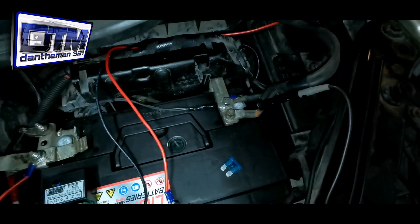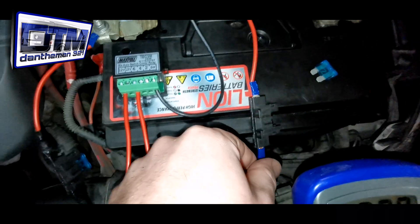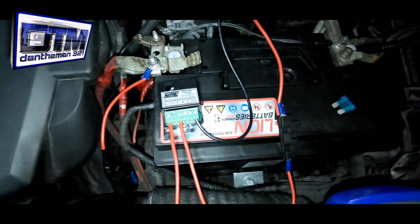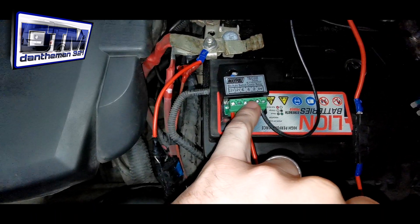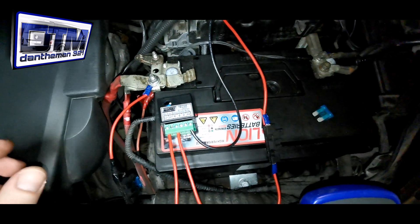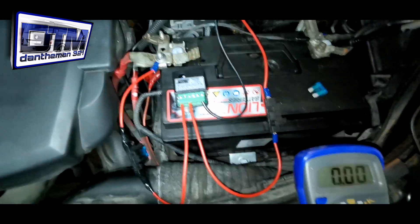By the way, this is all going to be covered in convoluted tubing — this is just in its raw form, I've just fitted it. So we've got the wire coming through, and this is what's going to the USBs in the back. We've got another inline fuse there, coming straight up into bank number six. Now for this to run on ignition only, you've got two sections: number six and number two. They're on switched mode, so as soon as your ignition kicks up and your vehicle's running, this will detect the voltage increase and those will become live.